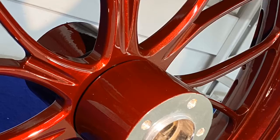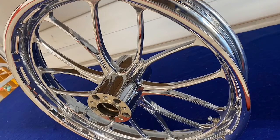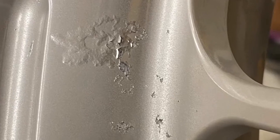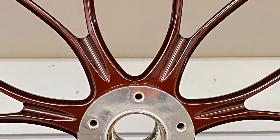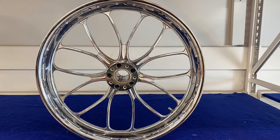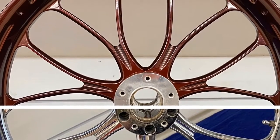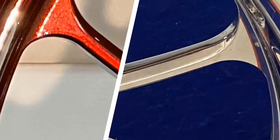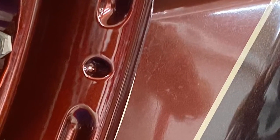D from Ride and Shine Customs brought us this chrome wheel that had a lot of pitting on it. We did a full blast on it, then hand-sanded to taper the edges of the metal where the chrome had lifted. We applied a filler primer powder, then laid down a base of candle green and top-coated it with lollipop red — that creates the color called Teredo Red. We were trying to match the color to the fairings on the bike, and as you can see in the picture, I think we did a pretty good job. So if you have a custom color you need matched, give us a call.